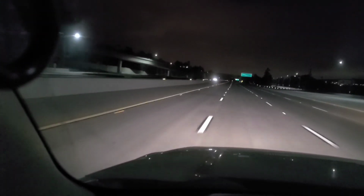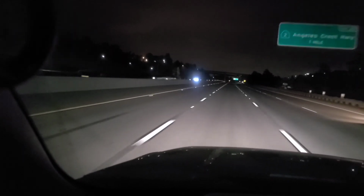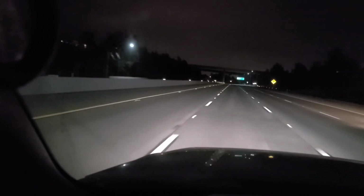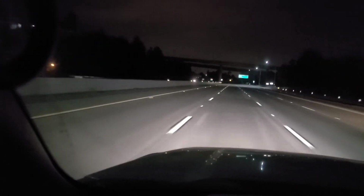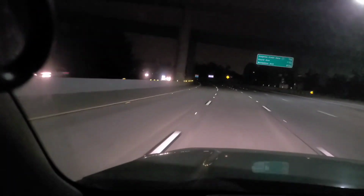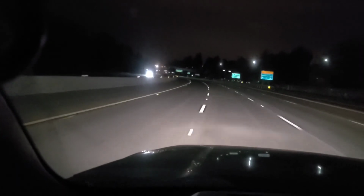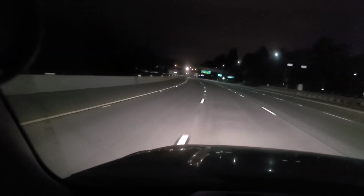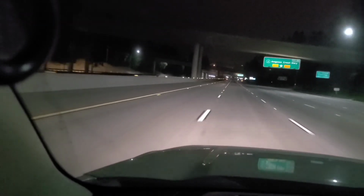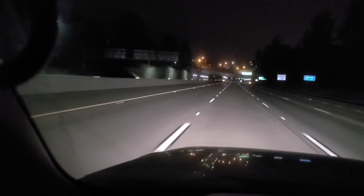Again, highly recommended. And once you get the vehicle and start using it, the rule of thumb for most of your big trucks is when you're going down a steep hill, and by steep, we're talking a prolonged hill over 4%, so 4, 5, and 6, something like the Conejo Grade or the Grapevine in California, I would consider steep, not stiff. The practice that I use is to find the gear or the speed at which the vehicle will hold its own speed only using the exhaust or supplemental braking system. In other words, you want the vehicle to not try and accelerate once you've activated the supplemental brake.